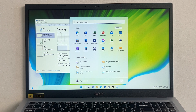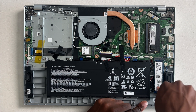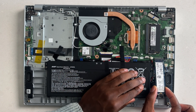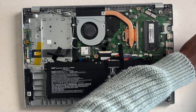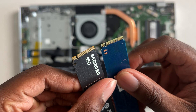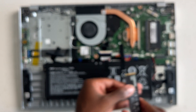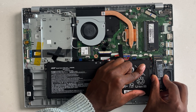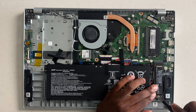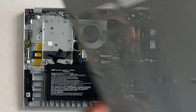Let's shut the computer down and open the laptop again. With the computer shut down, locate your NVMe drive. Unscrew the bottom screw — make sure you keep the screw — and it pops up a little so you can slide it out. Open the package for the new SSD; as you can see, the teeth are pretty much identical, which is why it doesn't really matter what NVMe you get as long as the pins match. Match up the pins with the fittings on the inside, shimmy it in, push down, and screw it back in. You should be good to go — clamp the laptop shut.